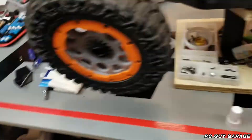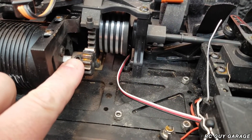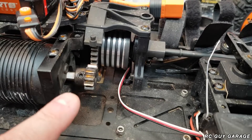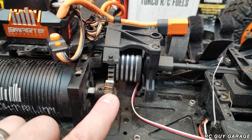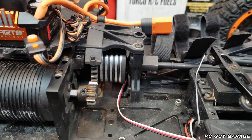So obviously we're back after our road-ripping excursion — the scenic route, you want to call it. We did obviously slip a pinion, which is fine. I'm actually glad that it slipped this way. The cover probably would have prevented it from going further that way. Didn't lose the set screw — it just backed off. Maybe that's the way it's designed; it's got to be something in there pitched a certain way, to make the pinion want to slip this way instead of slipping that way — some kind of alignment thing.